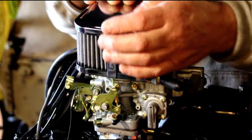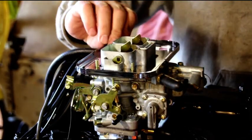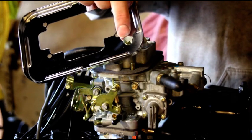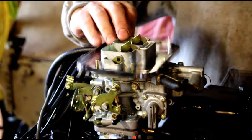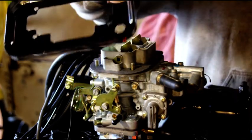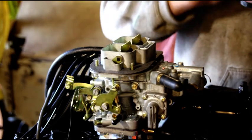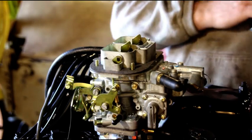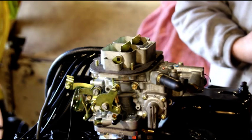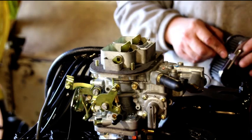It's kind of chrome-looking and it just doesn't seem to fit real well aesthetically. One thing you've got to do is plug that hole or connect it to your air cleaner — it's there for other applications, so either plug it or run it somewhere. Overall, it's not a bad setup, easy to do, doesn't cost any extra, and it works fine.